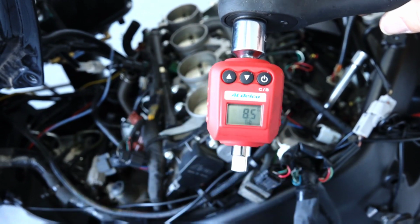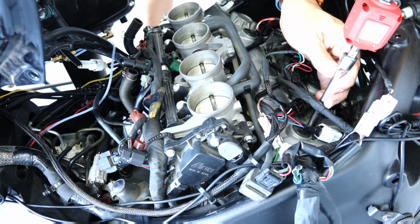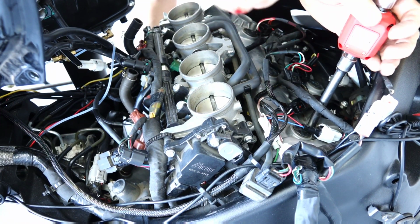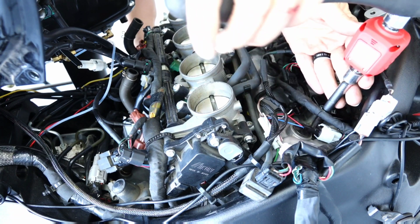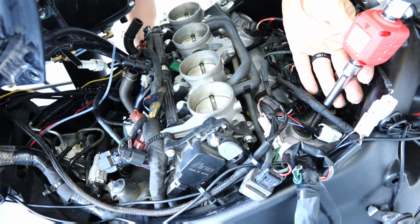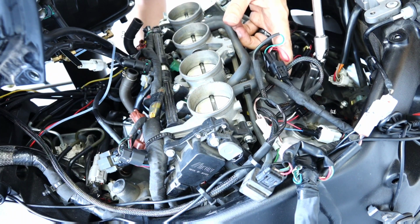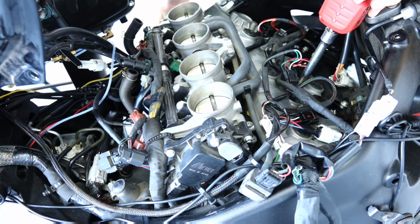And you know me, although not required, if I can take a safety measure and make sure that I'm not over tightening the spark plugs, I'm just gonna pull out my digital torque wrench, and if you're wondering, I set it to 8.5 foot-pounds.